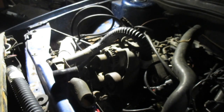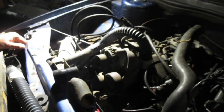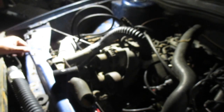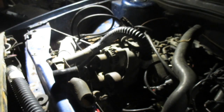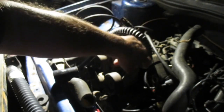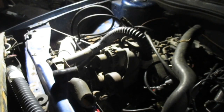What I'm thinking is I'm going to order a real short inch-and-a-half piece of hose and one of those radiator cap inline hose doohickeys — it's got a hose barb on the bottom, you stick it into the hose that sticks out of here, it's got one that sticks out the side, and it's got a radiator cap on top. So we'll just put a radiator cap right there.